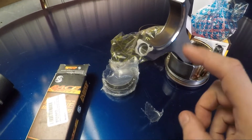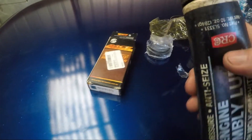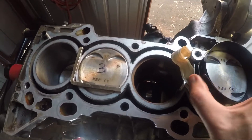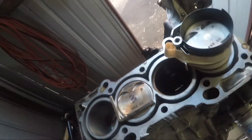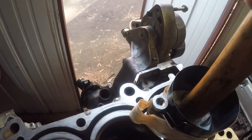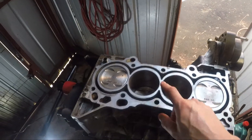Here I'm just getting the main bearings ready to go in. Use some assembly lube on those, and made sure they were the correct way for putting in the pistons. I use this cheap ratchet-style ring compressor. You need to be a little bit careful with these — they're not the best way of doing it, but it does work. Basically you just put the piston with the rings on, orientated the correct way, and then you just tap the top of the piston down with something soft — a piece of wood or the end of the hammer like I'm doing here. As you can see, I'm not using much force at all. You don't need much force — you just tap it in. If you hit something that feels like it's stopped, stop and check it out. Probably pull that piston out and redo it. But as you can see, we've got all the bottom end ready to go.